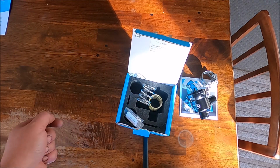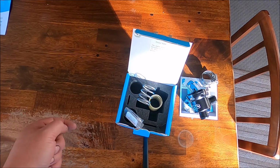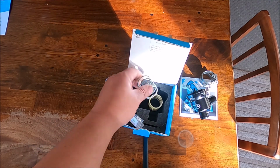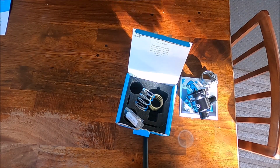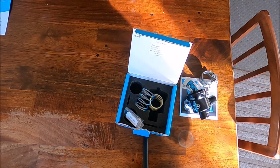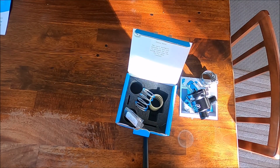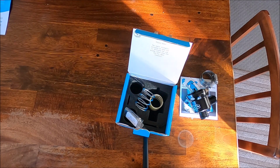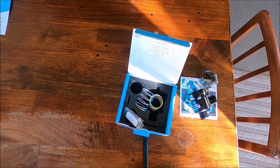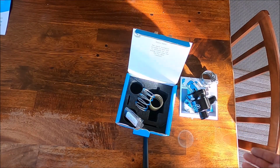But on the opposite end of the scale, if you're running too stiff on a relatively low boost car that doesn't need them to not open, it will not open when it should, as in when you let off the gas. So you end up with, rather than it recirculating, effectively just the same as running no dump valve at all, where you get chatter noise, which, yeah, I prefer chatter noise to dump valve anyway, but why have one in the first place if you're going to do that?